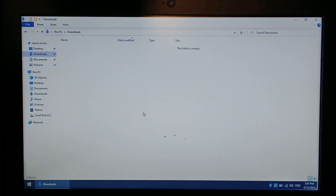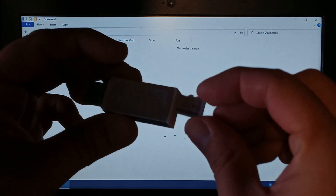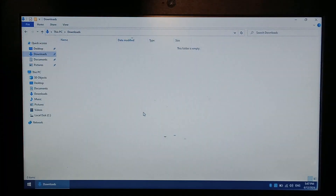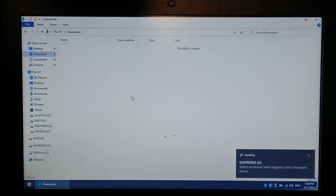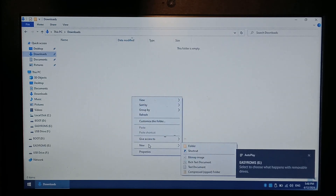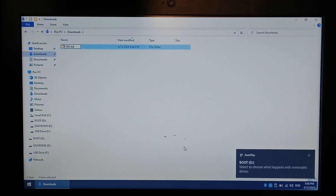We're over on the Windows 10 desktop now and the first thing I want to do is back up the SD card that came with my R36S. It's using a cheap USB 2 SD card reader, putting the SD card in and into the laptop. When it asks you to format, click cancel — it's very important. I'll make a new folder on my computer and call it R36S Backup.